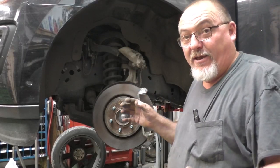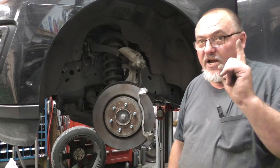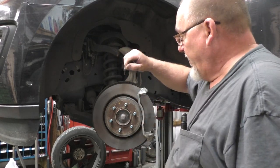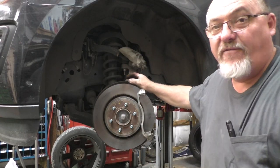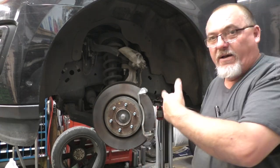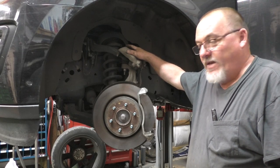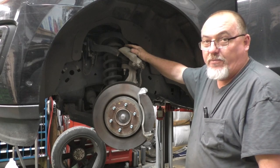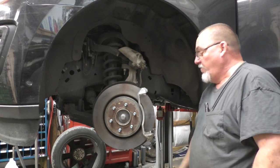I'm going to try to make these videos a little bit shorter. So what we're going to need in the front: we're going to do brakes and rotors all the way around. You will need a 13 millimeter wrench or socket and ratchet. You're also going to need a 21. Once you get your caliper off, you can hang it up here — they'll stay up perfectly fine as long as you don't beat and bang around.